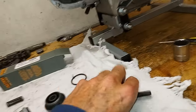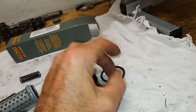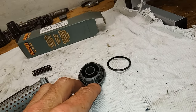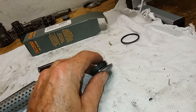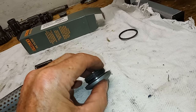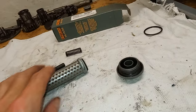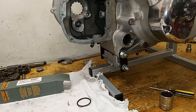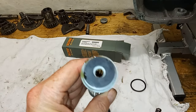I'm going to enlarge that hole to make sure it's fine. On the cap there's an o-ring seal that sits in the base of the cap — you need to change that. They don't leak, but obviously don't encourage it. Check the threads on the cap too, because they can wear with repeated oil changes. This one seems fine. So I'm going to enlarge the hole on the end of this replacement oil filter and then insert it into the engine.